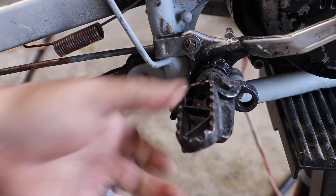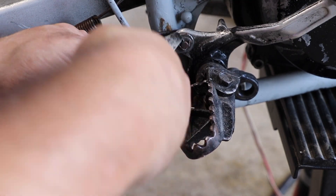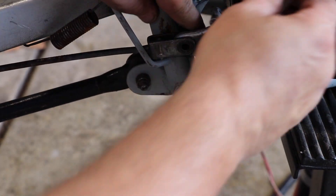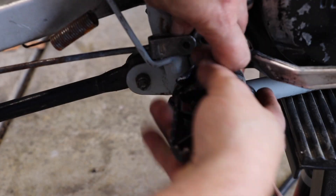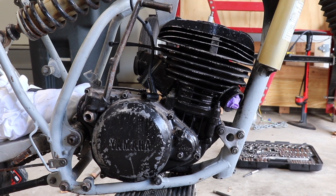Now, on the right-hand side, once you remove the peg, you'll notice it's kind of part of the actual brake lever. We're going to remove the whole assembly — we're just going to cut this cotter pin off, then push the pin all the way through. You can separate these two assemblies once you get this taken out. There's a clip on the back-hand side here. Since I'm not taking off the rear shock, I'm going to remove the engine.